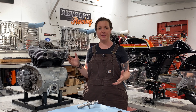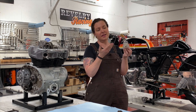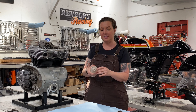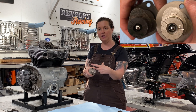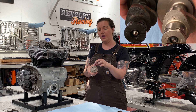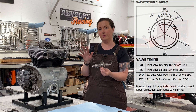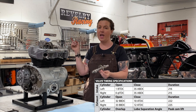What are your high-performance options for a cam in your Royal Enfield Twin? Today, your choices are the S&S cam — or the S&S cam. That's it; it's the only option. But it's a really good option — a beautiful camshaft machined out of billet. The secret sauce is right here in these cam lobes. These lobes decide when the valves open, how far they open, how long they open, and when they close. It also determines the overlap — how long the intake and exhaust valves are open at the same time. The S&S cam and stock cam specs will be in the description below, and we've included valve lift, which we couldn't find published anywhere, so we measured it ourselves.